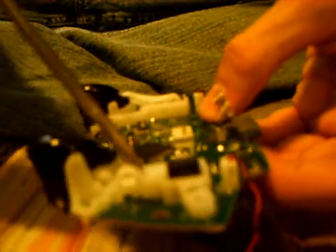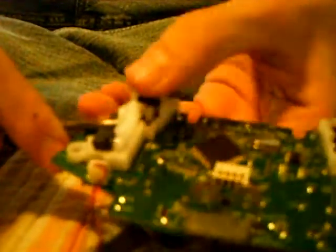And this is where you need that other screwdriver, because you need the little flap up, like you see here. This one's up, this one's down. This is probably one of the other hard parts. If it's your first time doing it, you simply get your small screwdriver or small little rod, whatever you have, to hold it up. I don't care if you even use an animal cracker to hold it up. It's your controller. What you do is you hold this up, push this to the side, push down, and it goes right in.